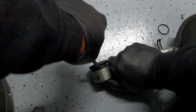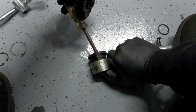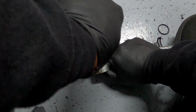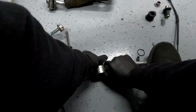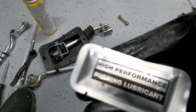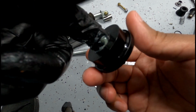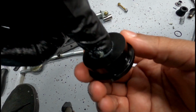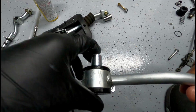For the lower linkage bushings, you can press it in or pry it out. It's in there pretty tight because the OEM unit is a single piece. You have to work around the ends of the bushing while applying continuous pressure from the opposite end. Once it's out, lubricate the new bushings with the supply grease or silicone paste. Most aftermarket bushings are multiple pieces, so generously lubricate all the contact surfaces and slide the pieces into place, not forgetting to insert the metal guide through the center.